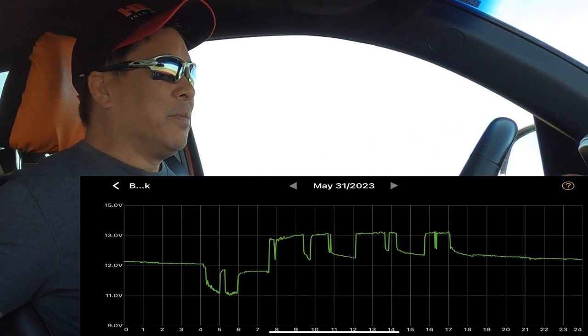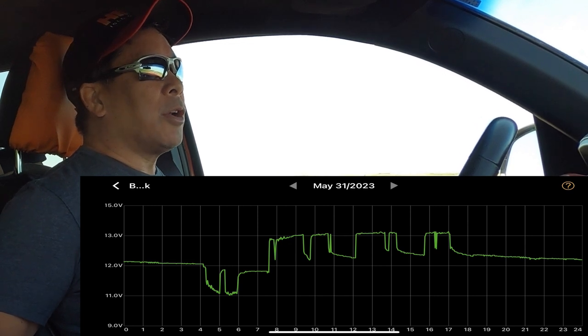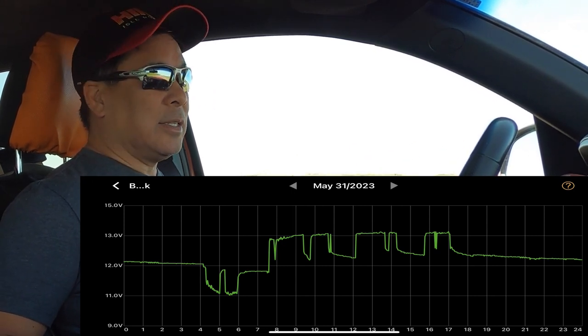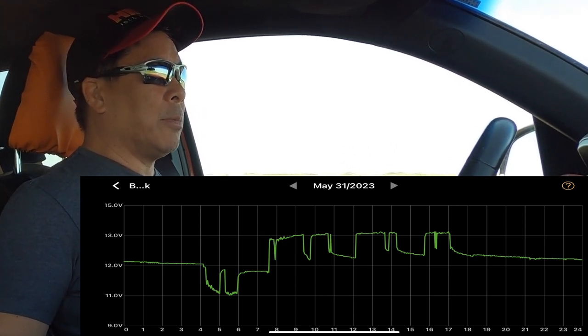Welcome to Montana — Montana really is big sky country, it's beautiful here. As I'm driving, I'm thinking about the ongoing electrical issues with the R-Pod. I have a Bluetooth battery monitor that connects to an app on my phone, so I'm able to monitor the output of the batteries on a daily basis. What you can see in this graph is that there are peaks and valleys every day. The peaks are when I'm driving — the tow vehicle is charging the battery of the R-Pod while I'm driving.